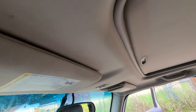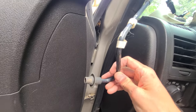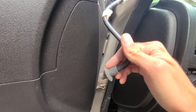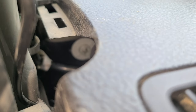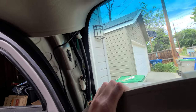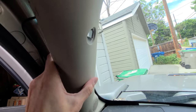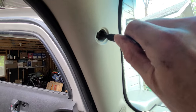At this step, if you wanted to open up your sunroof and in that overflow pan just pour in a little bit of water and wash out whatever was in there into a bucket or onto the ground. I'm going to pop mine back in, going up from underneath again. You'll be able to feel it snap when it's in there, and you really cannot see it. I'll put that little screw back in there.